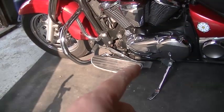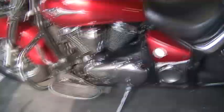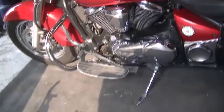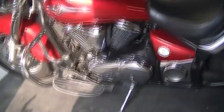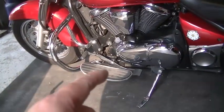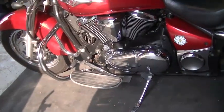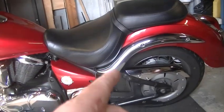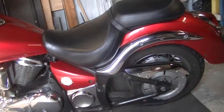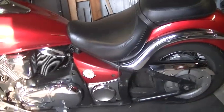I've taken the rear footrests off — they could actually go on there — and then do the linkage for the gear lever, and again on the other side for the brake bracket. Once I've got a single seat on it, it's more comfortable with the feet just slightly back. Going to bob it, meaning cutting the frame there, then a new mudguard on, and fabricate a new seat pan to accommodate the single seater.